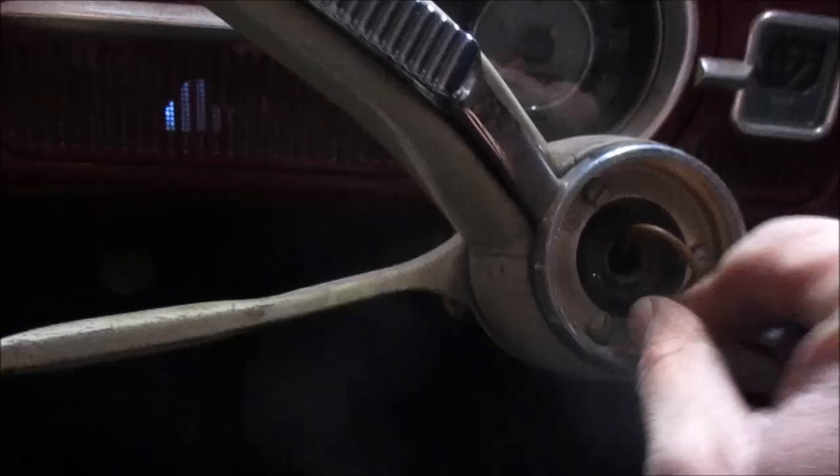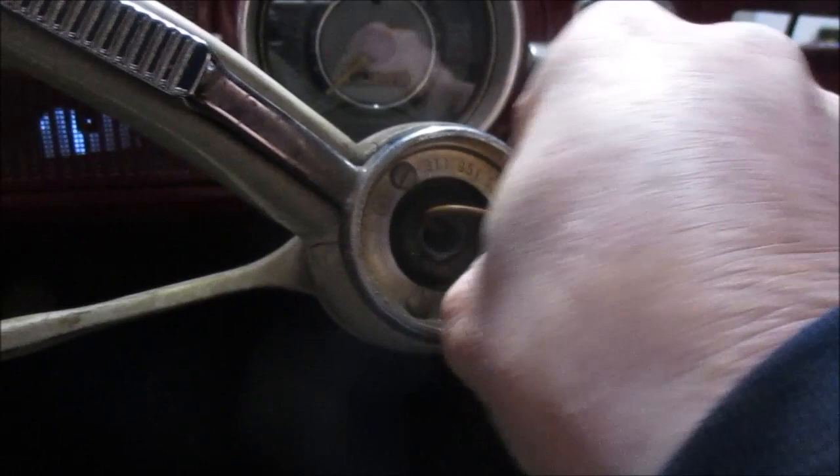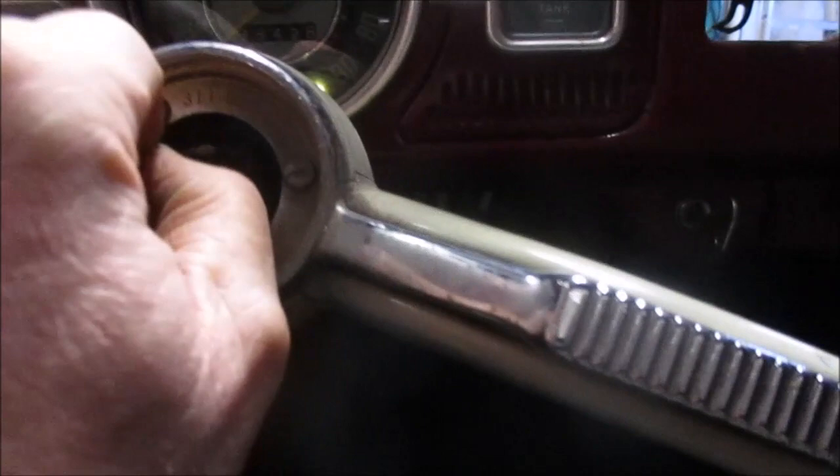All right, so I'm just gonna pull the wire off right here first, and I'm just gonna try and ground it to the column. That's where we're gonna start. Not really a good place to set you guys, really. So I'm gonna need both my hands, maybe. Maybe not. So there must be a break in this wire somewhere.